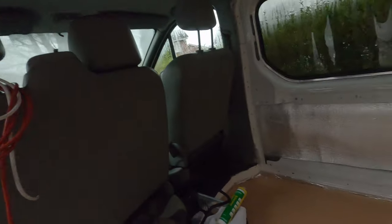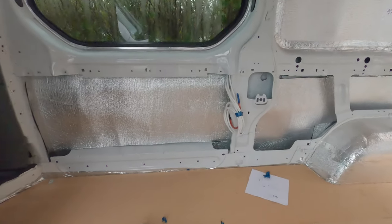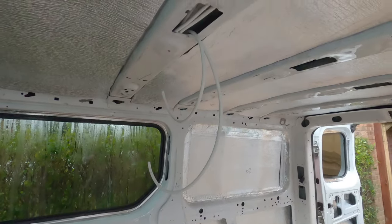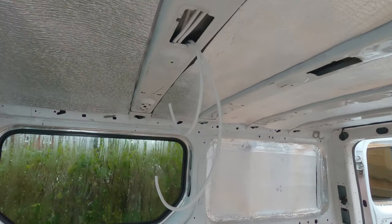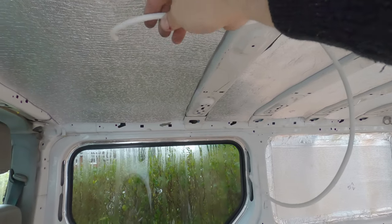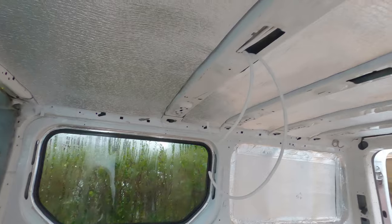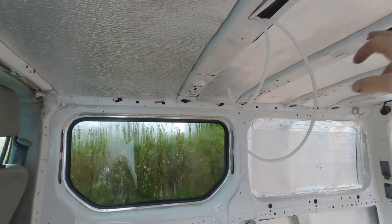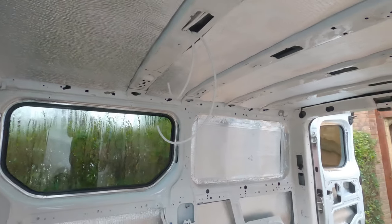Okie dokie. So, we've got 5 lighting cables installed now, for the 5 lighting circuits, and let me show you where each of them goes. So from the main control point over there, I have 2 coming to this central point here. One of them is going to feed the main lighting rig, the 4 down the middle of the van. The other one is going to feed the LED ring around the outside.